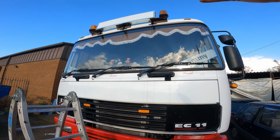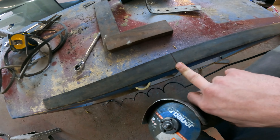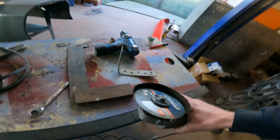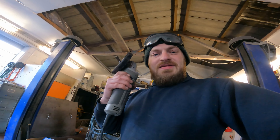So I've got the sun visors and the box on - not properly but it's on. You can see what I mean about the brackets that go solid. That's not going to go anywhere. I'm going to put them on because I want to mark them up. I might even tack weld them in place so I can take it all down at once and weld them up in situ without having welding spatter fall on the windscreen. Marked up my bar. It's 36 in the middle there, each side. I've already cut the end off. So now I'm going to cut this and I've got two bits of flat I can bend and make into my brackets to support it.